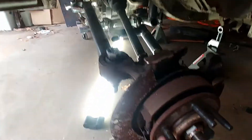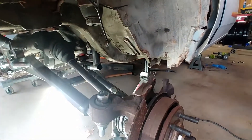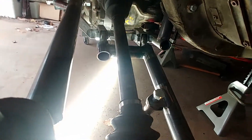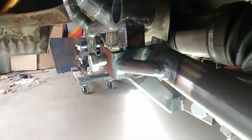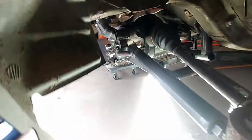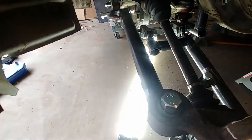These arms work pretty well — as it goes up it doesn't have hardly any camber gain, just a tiny amount, as the upper arm is slightly shorter than the lower arm. Something to keep in mind when making arms: you need three points of contact, otherwise it can freely rotate. The bottom arm is super solid because we have two separate arm joints, whereas the upper arm I created two separate mounting points by spacing out the mounting so it can't rotate as much. The shock mount is going to go on this arm, so all the pressure will be pushing it down.